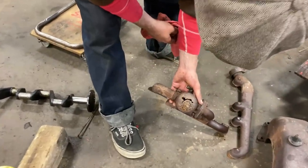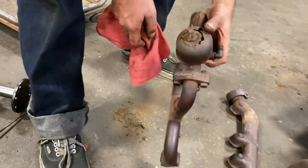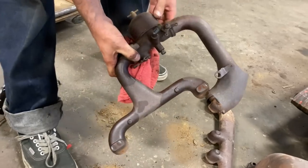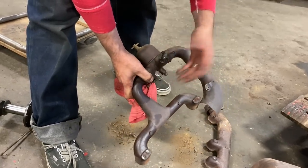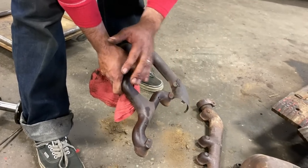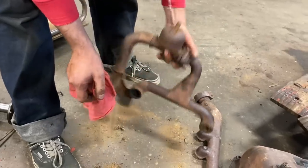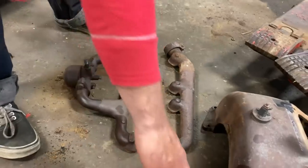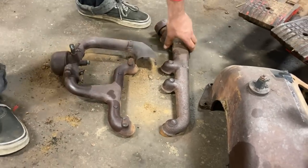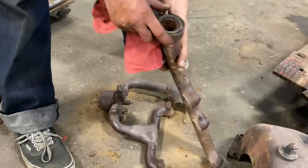Looking at this carburetor now — the fuel bowl is pretty soft. That's probably new gas with ethanol sitting in it, causing the problem. The body might still be good, there are good parts. We'll check the manifolds for straightness. Like a little pack rat — we use every part of the buffalo around here. The exhaust manifold doesn't seem to be cracked, but you've got to check them for warping. Somebody added a clamp to it, so they had nut trouble.